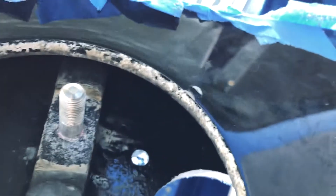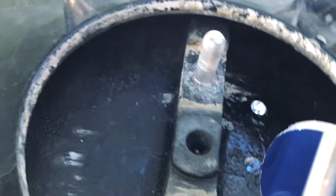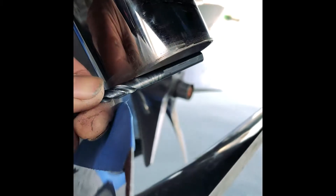There's a little bit of room there. This is the first pilot hole we drilled to knock the anode out — that's going to be covered by the gasket. It would have been nice to get it right in the center, but you can see this drive is hollow. Looking up inside, you can see some aluminum shavings in there, and we've got this thing cut perfectly.